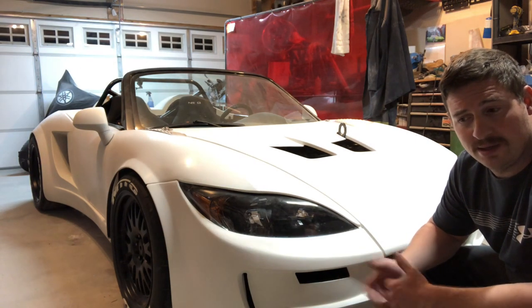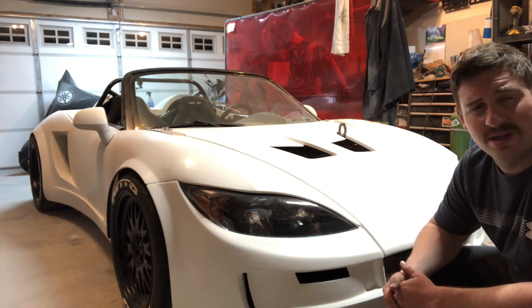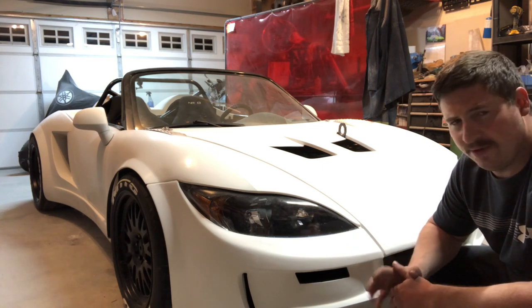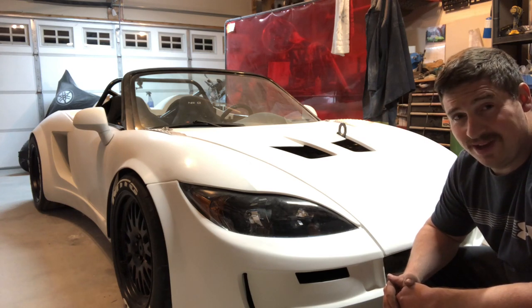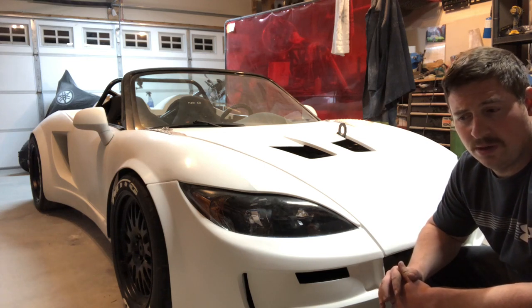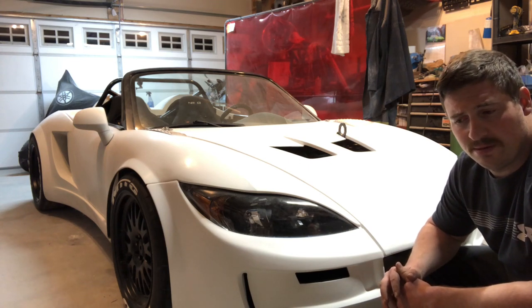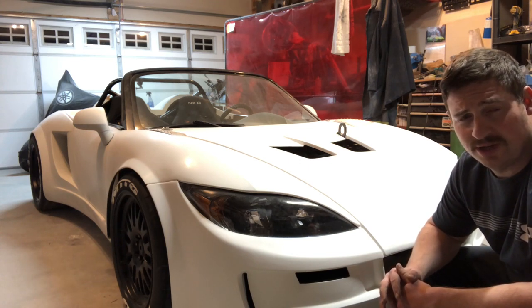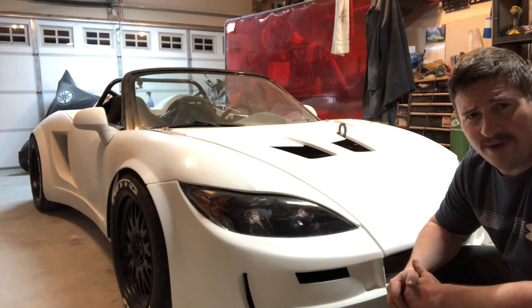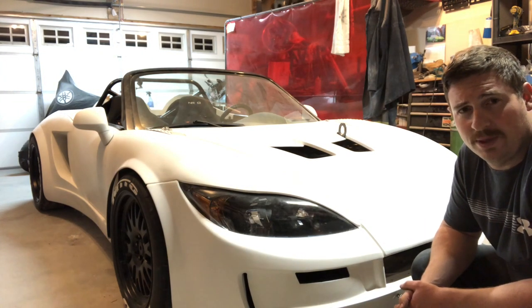I set up the wastegate a long time ago based on, I'm not even sure what information. I'm sure I looked it up in the install manual for the turbo. So we'll keep an eye on that. I definitely need to set some fail safes, so we're not gonna overboost, because we don't have enough fuel in it for too much boost. It's still the stock fuel injectors. I do have upgraded stuff, but the pump is also only a Walbro 255, so basically the whole fuel system's gonna need an overhaul this winter, and that was always the plan.